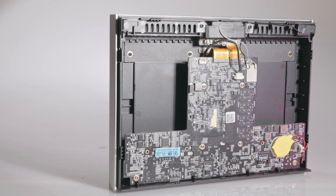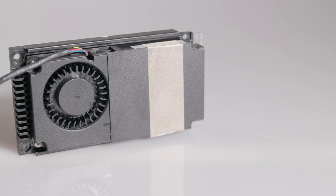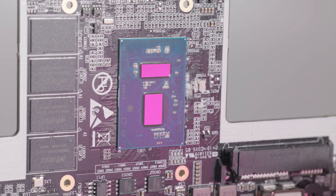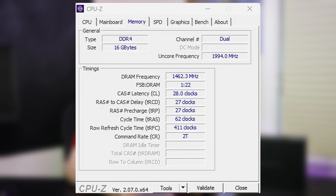Once I took out the main board, I can see the CPU itself, which plugs into a small heatsink with a tiny fan on it. Under this heatsink is the Intel N5105 processor. The CPU has its included graphics enabled on the system, as well as four E-core or Atom-based cores for all the processing. Clock speeds go anywhere between about 2 GHz to 2.9 GHz depending on the workload, sitting roughly in the 2.5–2.6 GHz range under moderately intensive all-core loads and peaking at 2.9 GHz on light single-threaded tasks.